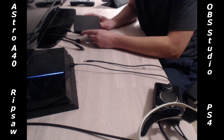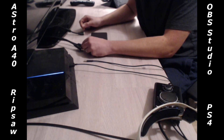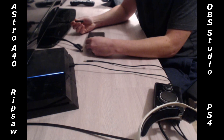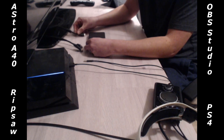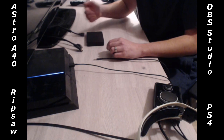After you've downloaded the Razer Synapse program, you're going to take the video capture card. One thing I did is I pre-ran all my cords. I've got an HDMI cord going to the PlayStation, and also an HDMI cord going to my TV for passthrough — that will send the signal from the PlayStation through the capture card and straight to the TV. I also have my USB 3.0 cord pre-run to the blue port on the computer. There's a standard USB 2.0 port which is white — you want to run this to the USB 3.0 blue port. I also have the audio cord pre-run to my Astro A40 headset. I recommend pre-running the cords so it's easier to plug everything in.